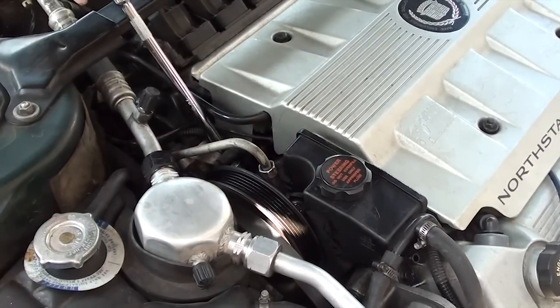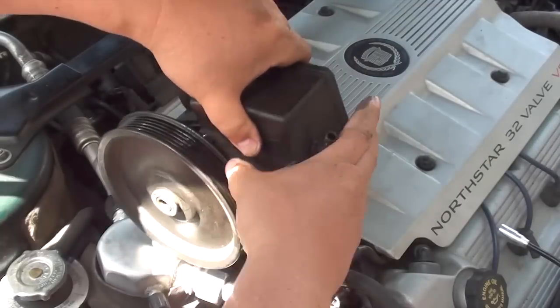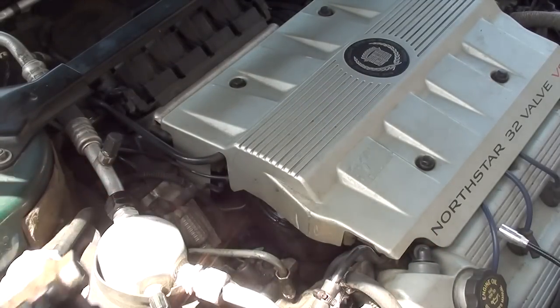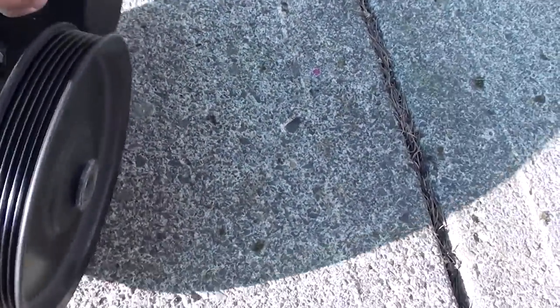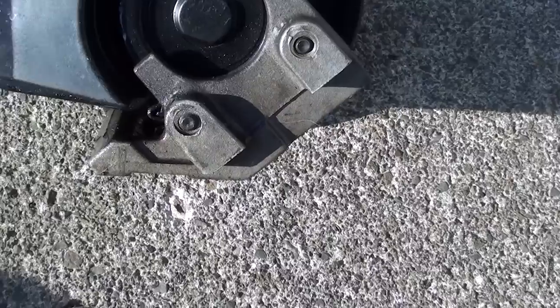You can see it's starting to get loose. Once you've got everything off, the pump is ready to come out. You can't pull the pump straight up — you've got to slightly tilt the top forward and the bottom back. There's a lip that the pump has, and I'll show you here in a second. You can see where the bolt is — there it is. You can see that hole, that's where the bolt goes in the back, and there's the lip I was talking about.